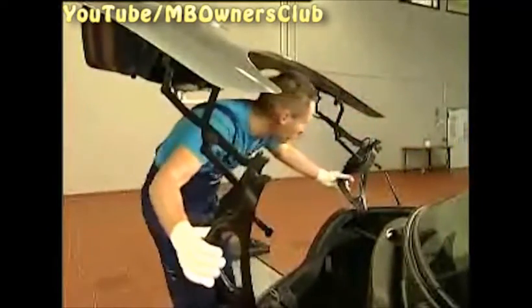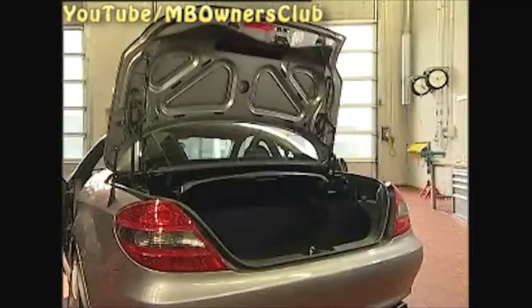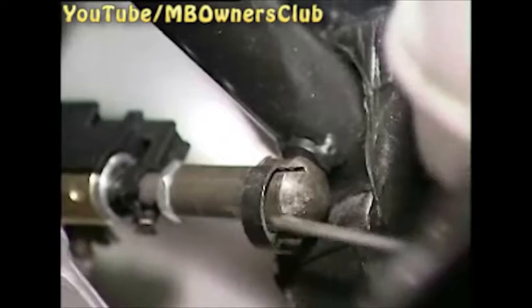In the next step, we devote ourselves again to the tubular frame. Lead it steadily into both guide bolts. Then open the trunk lining. Then, with a suitable screwdriver, remove the safety and disconnect the hydraulic cylinder from the tubular frame. Repeat this process on the left side.